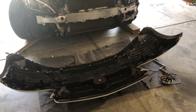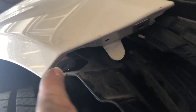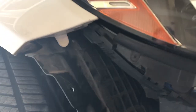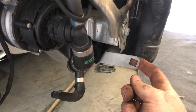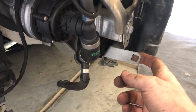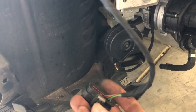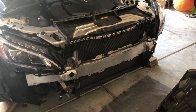Amazing — 5 minutes. You saw me struggle a little bit. There was another hidden bolt up here, so there's one on the outside that you can get to and one more up here that you just have to know is there — you've got to pull this cover back a little bit more. I just didn't see it in the dark. And when the bumper kind of fell forward, I saw there's two more bolts here on each side. You can most likely get to these before you take off the rest of the bolts — for me it dropped down and I was able to get to them. Then I just have one connector down here — pull this little gray tab up and give it a yank and it'll come right out. So the whole front is off. I've been working on this for about 40 minutes.